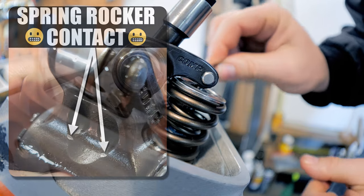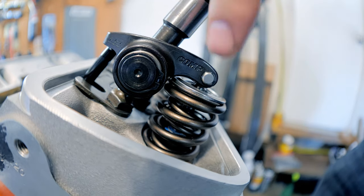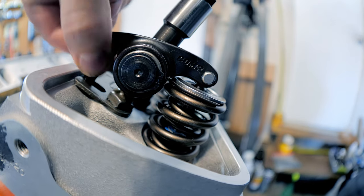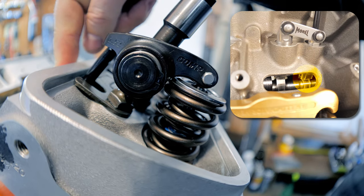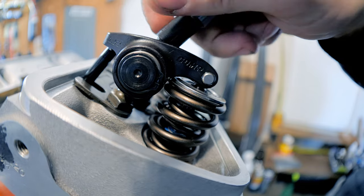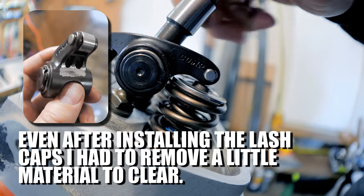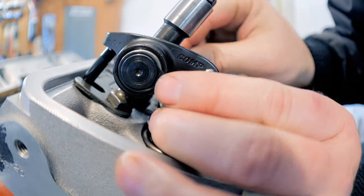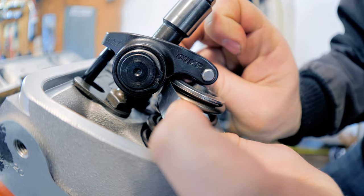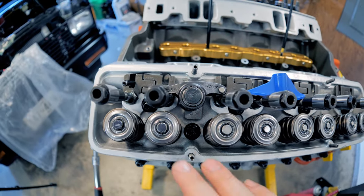Let's talk about clearance. This right here is a lash cap for your valve — what it does is it makes the valve stem come up slightly more to have clearance when your springs get bigger. I've removed the lash cap just to illustrate this issue. Here is just a six-thousandths feeler gauge. If I try to get this in here, I cannot get it past the top of that valve spring, because on the back of this rocker, even after the clearancing I've done, it is binding right there. That is a huge issue. You have to check this on the bottom of the lobe of the cam when it's all the way down. Now let me pull this off and put the lash cap on.